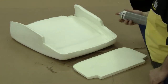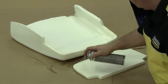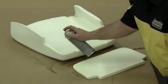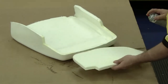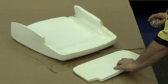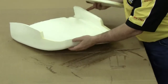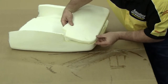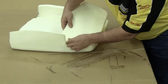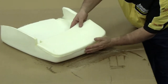On our front seat top, we will first need to glue the headrest cap area. We generously coat both sides — the headrest cap and the base foam area — and glue those together, creating a little pocket that we can slide our foam over the top of our seat frame. When attaching the two pieces together, start at one edge or corner and carefully place the two edges together. Take your time doing this because it's very important not to leave a ridge, as that ridge will be visible through your new upholstery if you're not careful lining it up.